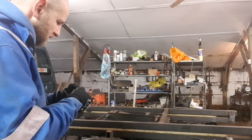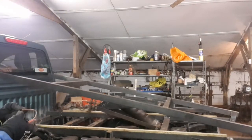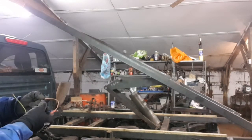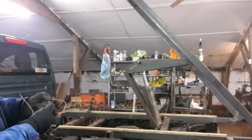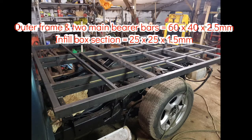Now it's all mounted, I've wired the pump up and connected the hose from the pump to the ram. As you can see, as we force the hydraulic fluid in — I'm just hot wiring it at the moment — it opens the ram up, which opens that fabrication and causes the body to tip. With the pump up and all the hydraulics in place, I can continue building the bed.